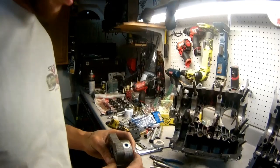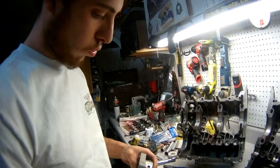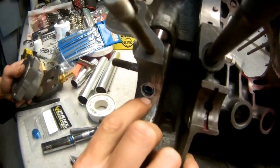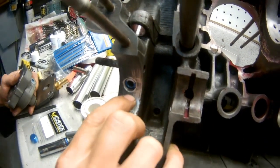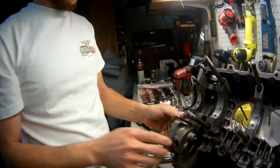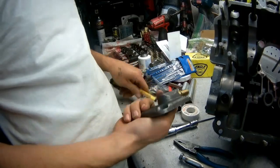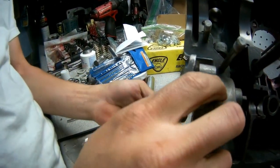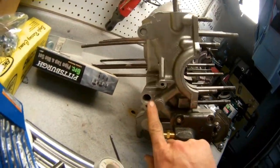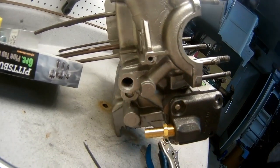What we've just done is tapped with NPT threads the outgoing port on this oil pump and plugged it. We've also plugged the case - this one's actually one quarter inch, as opposed to the other one being three eighths. That is so when we put this together, instead of pumping directly into the block, it's going to go out of the block through this. So we're going full flow, external oil, and we'll run an oil filter and an oil cooler. It comes back into the block right here through this machined hole. Normally it would be like a boss there with a little pin that usually seals that off.